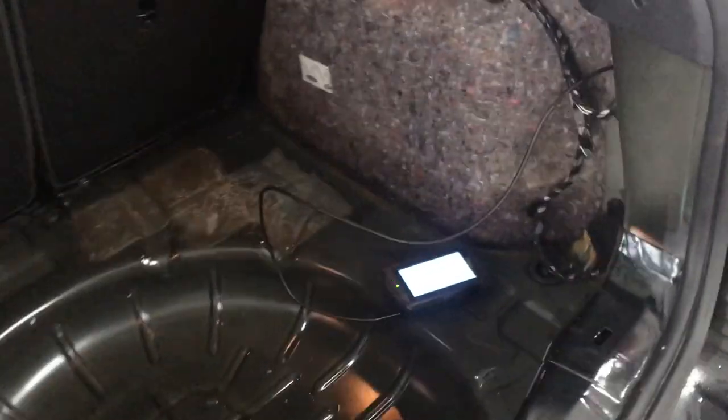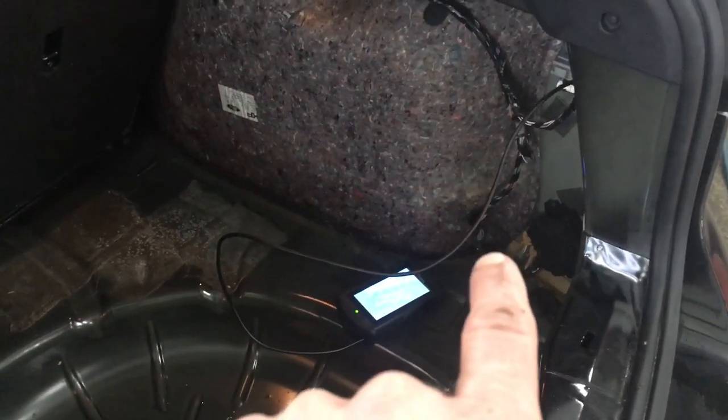I'm going to quickly go in and see what we find on this side. As you can see, visually there's been water coming down here. We've put our camera down this flexy little hole, and if we go inside — there we go — we've got the air vent on the inside. You can see that there's water passing through into the box section, and very closely you can see that box section is filled up with water.